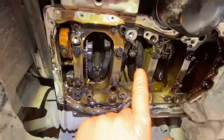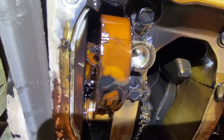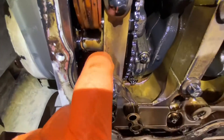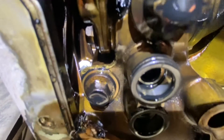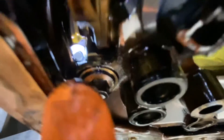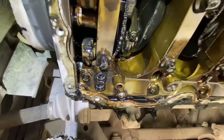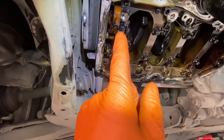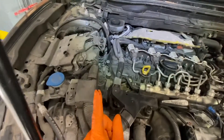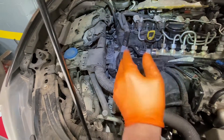The engine is still running - may run off a set of big end bearings, which you've seen me doing before, no need to show you that. What I want to show you is just in there - you can see a bit of the actual tensioner has broken, a piece of the plastic guide has fallen off the back of the guide here, and there's a bolt broken off in there. Today's video is going to be a full timing chain job - the engine timing chain and the actual timing chain for the oil pump and balance shaft. That's the task. We're doing a complete teardown: injectors out, rocker cover off, and I'll be pulling off the ECU and stuff to make room to get in and get this timing chain replaced.